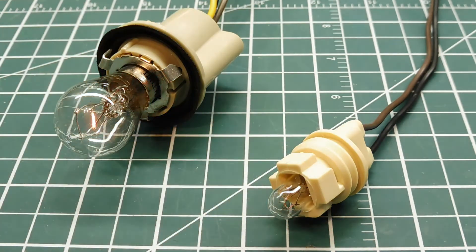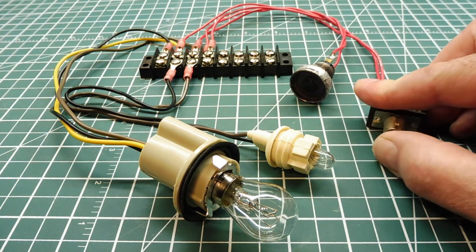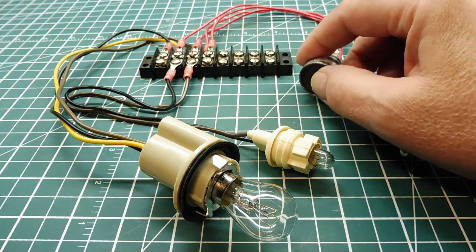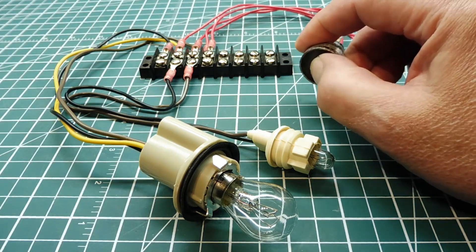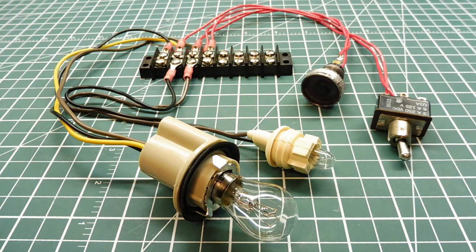So how would you build it? How would you design this circuit the way it was built in the 1970s on the GM cars? Here's my circuit layout — this is the same circuit GM used, and it's pretty simple. Just the two bulbs: there's my 1157 bulb and there's my marker bulb. This switch is my on/off switch for the parking light, and this is my blinker module to simulate blinking. Very simple circuit — no relays, no transistors, no diodes, just the two bulbs.